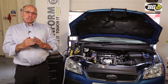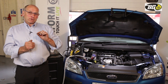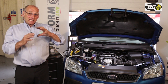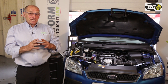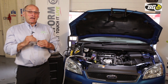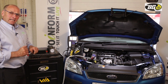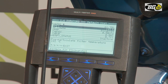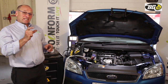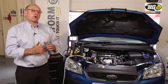It's important to get the temperature as high as possible before introducing the product. This stage of the process is to deliver the product and saturate the DPF, done at the highest possible temperature and lowest possible engine speed. I'll turn the control valve on now — the product should now be delivered into the engine intake system. There is a sight glass on the delivery hose to confirm flow.